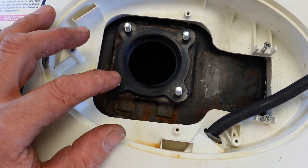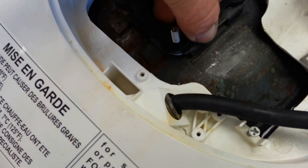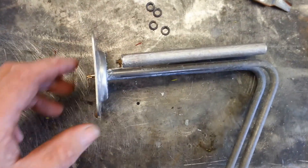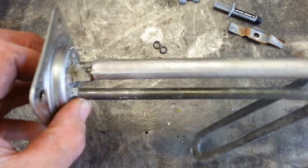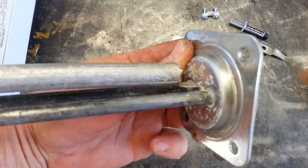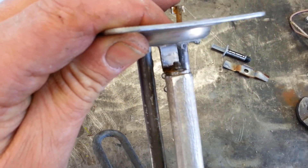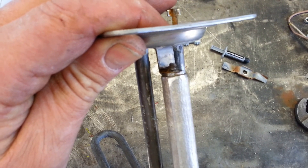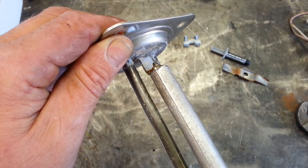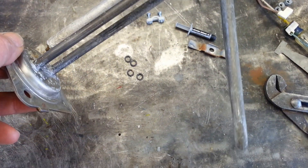The gasket came with new bolts and these bolts just slip in underneath the gasket. They're on a slotted hole and it's a carriage type bolt. I have my new anode installed and I've got the element all cleaned up — I scotch-brited it and got all the scale off of it. The only thing that gave me any trouble was that little thread. It threads in there and it is a metric thread. The old one was rusted and corroded and I actually had to pick it out with a carbide-tipped scribe. I put a little anti-seize on it and the new one threaded right in. That's what the new anode rod looks like — it's worth it to pull yours apart to check that.